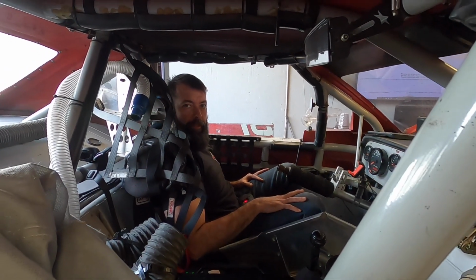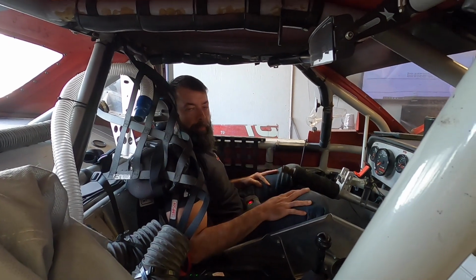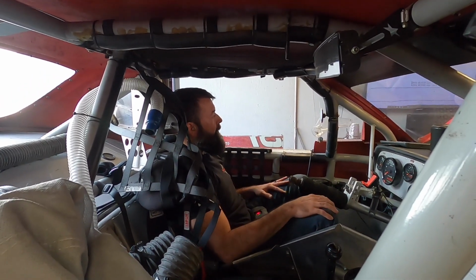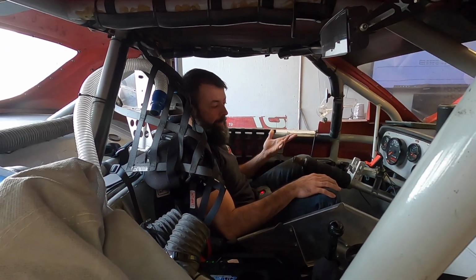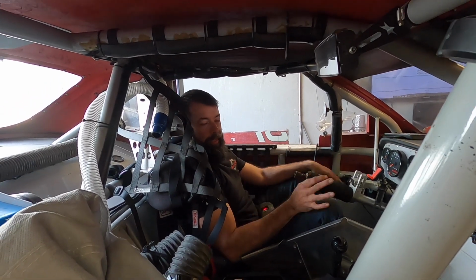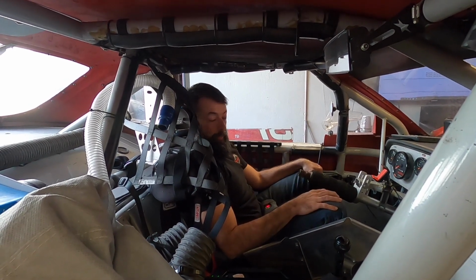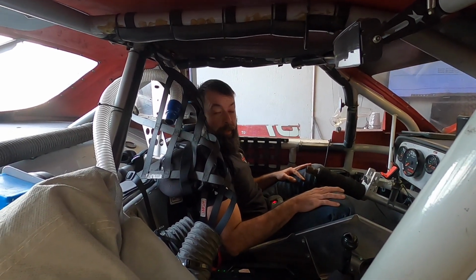Well, this thing is definitely something. Not quite making the power that we need to make at all yet, but that's not a bad start. 479. It is still plenty lean. We've got the old timing curve. I expect that this thing wants more spark, being as it has a gigantic exhaust. We're on 110 octane or something like that, and it's got a lot of overlap with the cam. So we'll see how she goes, but I'll keep you guys posted on this. This is going to be a mission.